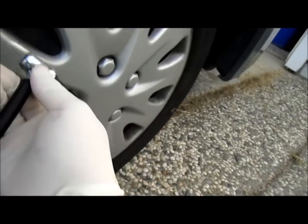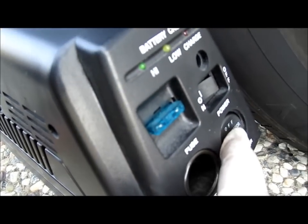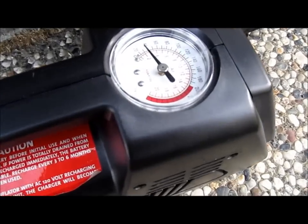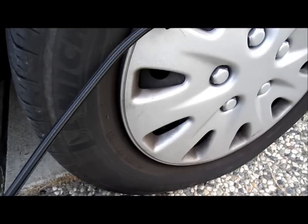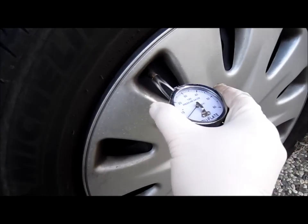So then you take the compressor unit over here for tire pressure. Put it on, lock it, turn the unit to on, then turn the compressor on. Let it run until it reaches 35 PSI. Make sure you stop the unit before you pull it out — unlock it, pull it out, then plug the gauge in and see how much pressure is there now.